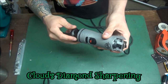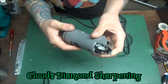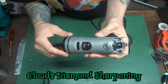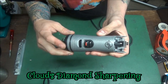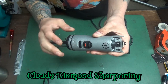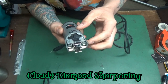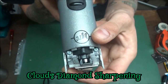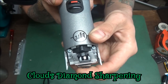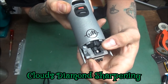I work on them also. When I get one in they're brand new, so most of them get sent back for warranty and I don't see very many of them. So this looks pretty clean. His problem is he says it alternates in speed, so my guess would be there's carbon around the armature preventing it from spinning and making complete contact. So we're going to clean the armature, take the motor out, replace anything that needs to be replaced. The drive lock bearing is not broken because it's not wobbling right now — the drive is not wobbling, so it's good.